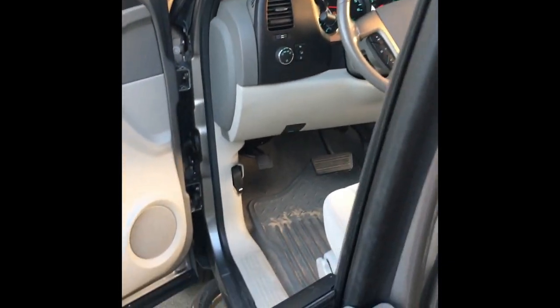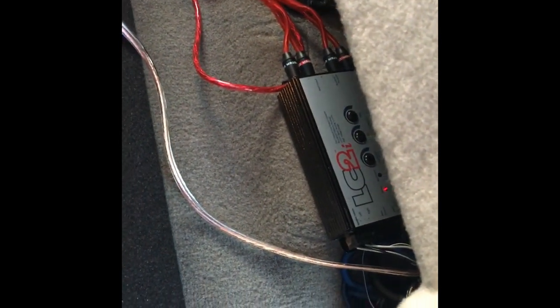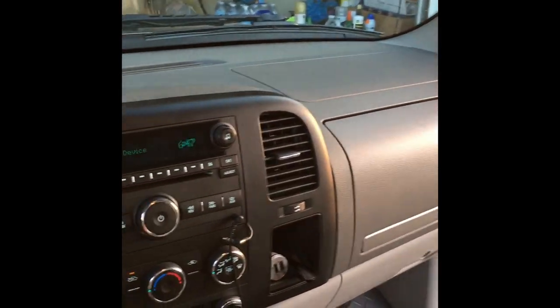So far that's what I have guys. I was gonna make a video on how to install the subwoofer and the amp and all that, but I'm sure you can find plenty of videos on that. It's plain and simple — you run the power wire from the battery down the side all the way down. I have the ground where the seatbelt ties in — I took that off, sanded it down. Grounded the LC2i and the power with the power distributor box, just tucked down about there. Everything sounds really good. I'm going with the same brand speakers — JBL — but I'm gonna put the coaxial on the back. There's the tweeters and they sound really good. Let's see if I can find a song I can put on here without getting copyrighted, and I'll let you hear what they sound like.